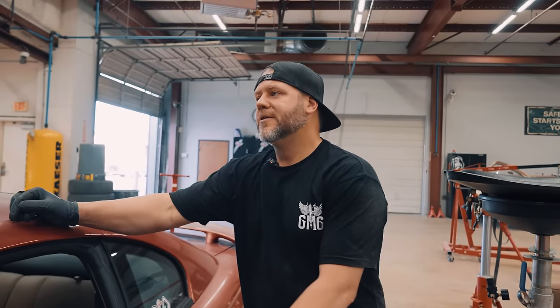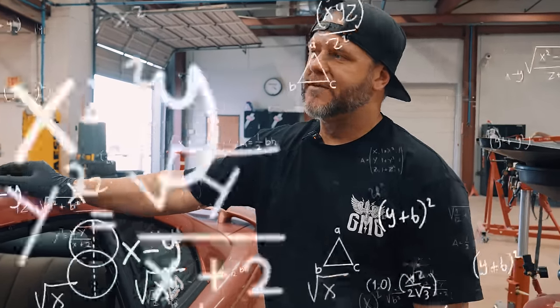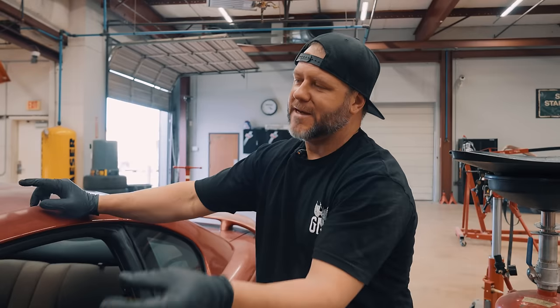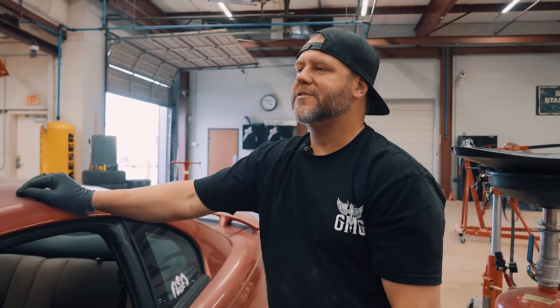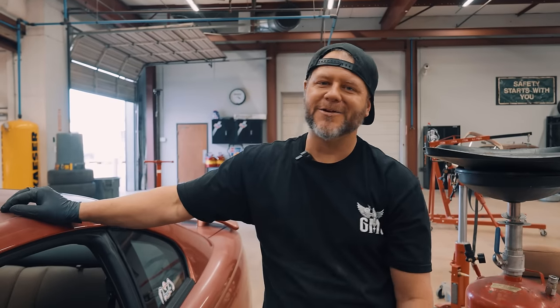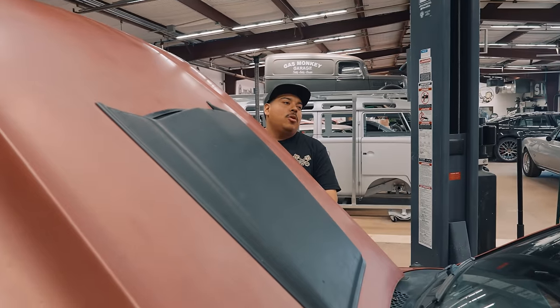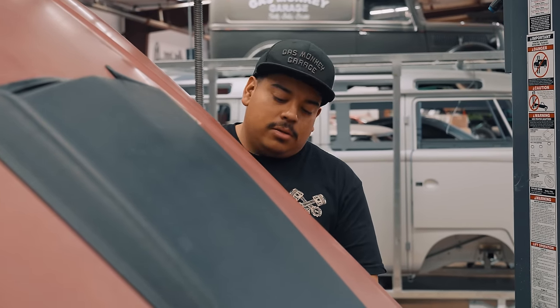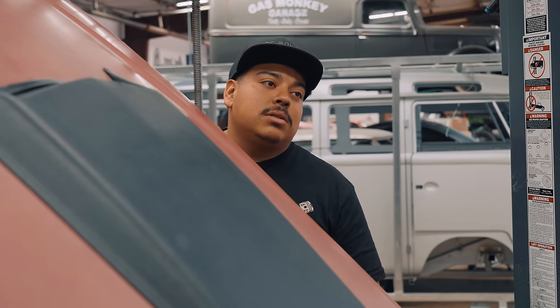My harmonic balancer doesn't seem to have all the markings on it. We could measure the diameter times pi, divide it, and figure out a reference for how far 15 and 30 degrees would be and put it on a piece of tape — but I don't think we've got enough room. We're just going to turn it on and hit it with a timing light, turn the distributor, and try to get it somewhere away from 90 degrees. I'm hoping the Summit line is zero — as long as we can keep the light on zero, we can adjust here to how many degrees. Right now we're at 38 degrees, so as long as the timing light is on zero, that's 38 degrees.